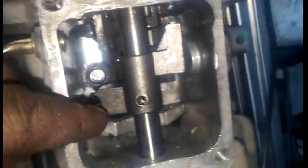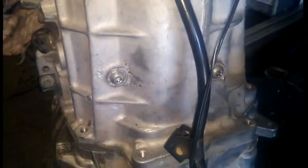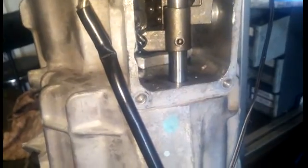I'm having problems removing this. There's something wrong with this trans that the first one didn't have. This pin will not come out — the ball's trapped behind it. No matter what I did, I could not get it in the right location. So I tried removing the T40 Torx bits on the shifter plate in the very back. However, that hasn't done anything either. And I've run into another problem: these are also T40 — those are your shifter bolts for your shift rail, and those must come out for the case to come out. That lines up your shift rail, and without that, it won't shift properly. I've snapped two T40 Torx bits — a Husky and a Craftsman — and bent a third one. I'm not quite sure what I'm going to do for those bolts. As for the pin, I think I'm unfortunately going to wind up drilling that pin out. I've got extras.